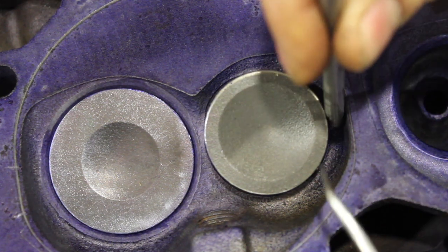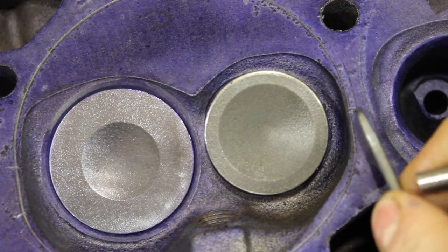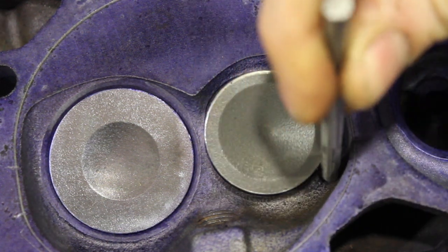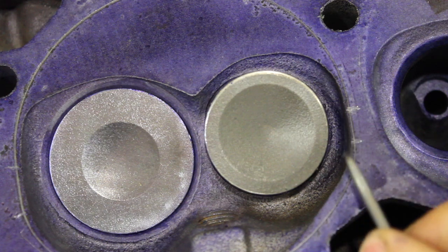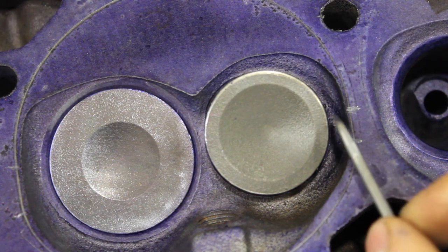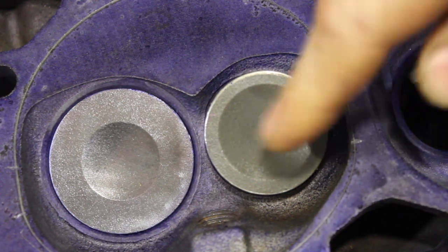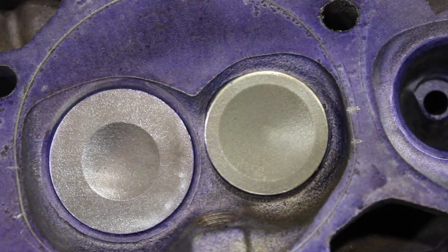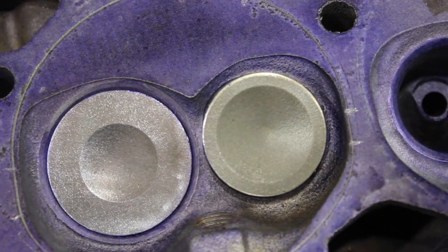With the exhaust, same thing — bring the dowel around. The exhaust, you don't have to take much out. You're pretty much just taking it to the head gasket line that you made, the bore. You're really just cleaning up this section here and kind of helping with the swirl. You don't have to go up past this point here, so you're just cleaning a little bit. I'll show you in the flow charts what difference that little bit of cleaning up made. Let's go ahead and do that and I'll show you what it looks like.